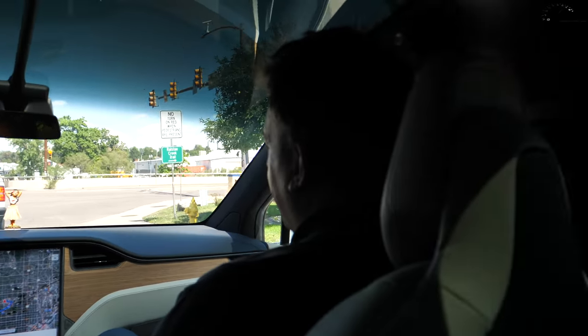Well, so we should kind of explain the issue. What we think the issue is, because the trailer draws so little power from the actual vehicle, we think that the car doesn't even recognize it because the LED lights just don't use any oomph, right? Yep. So we're essentially getting something to plug into the car that forces it to use more power to recognize the trailer, which is exactly what you want when you have an electric car with only a limited amount of range.